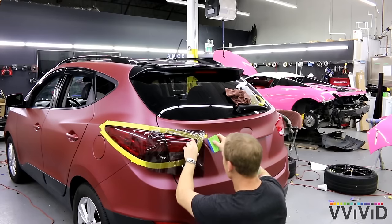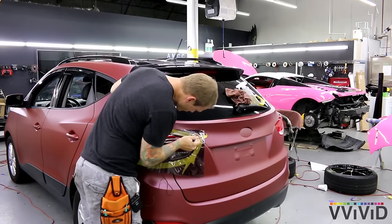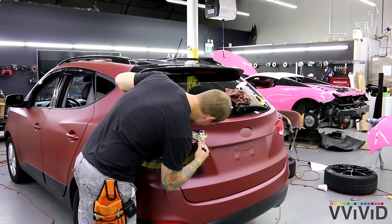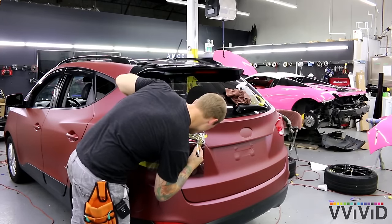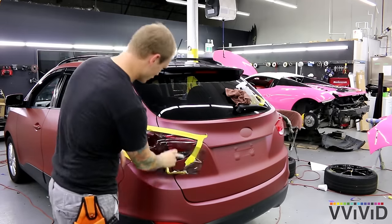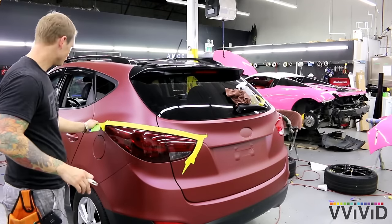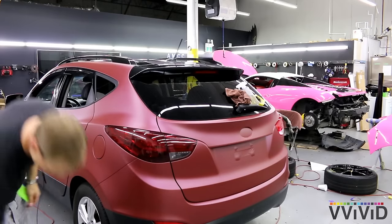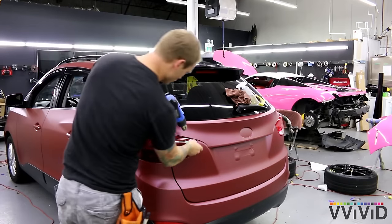This piece is already tinted — that's all done. No stretch needed, which means we don't have to do any preheating before we cut. You still need to go over the edge with heat — that's a mandatory thing. So even if you don't stretch it, you're still going to go over the edge with heat.